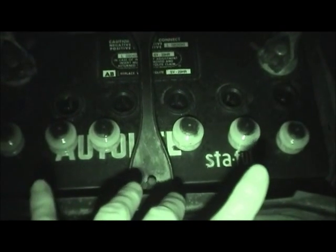I kind of like the idea of having the mechanical regulator in there — it's neat how it works, and it keeps the originality of the car. Batteries are basically considered consumable items. There's no way a battery is going to last 42 years. So it's understandable to replace batteries, coolant hoses, fan belts, and things like that. But actual components like the alternator, voltage regulator, and distributor — I want to keep all those parts original as much as I can. In fact, the alternator I actually rebuilt — put new bearings in it, new brushes, new rectifier. That thing is basically like new, even though it looks like it's 40-some-odd years old.